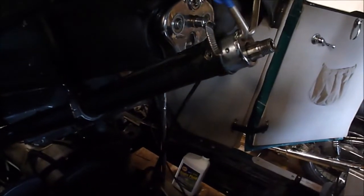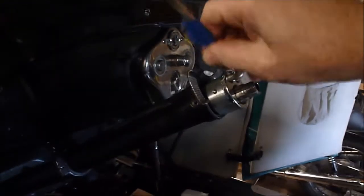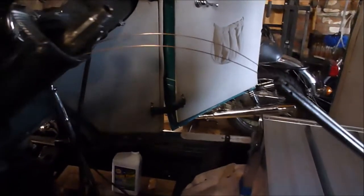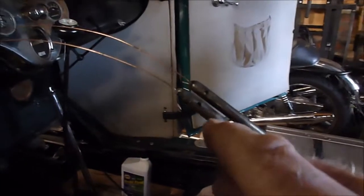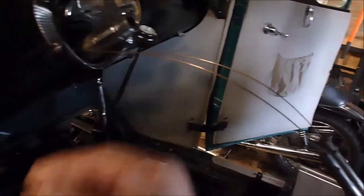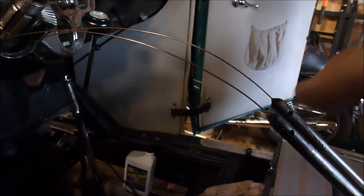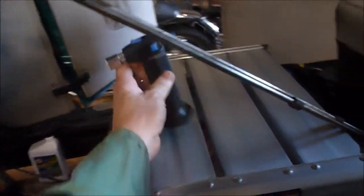I had to get smart. I'm looking at this thing thinking, how do I get this in? The tolerance around these rods for this hole is tight — same thing down there. So I drilled a 1/16th inch hole down about a half inch into the rod end. You don't want to go into the hole, because you could risk getting solder in those holes and having to clean them out. I took some welding rod out of my MIG welder — this is 30 thou, nice stout stuff. I wanted something that could take it if I had to pull it. I soldered that in with just regular pipe solder you'd use for your bathroom fixtures, and one of those little Bernzomatic torches. The temperature was nice and it came up really compact and easy — the solder easily sweated into there.